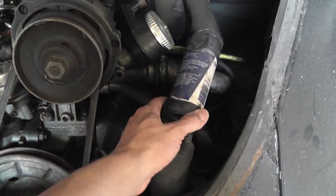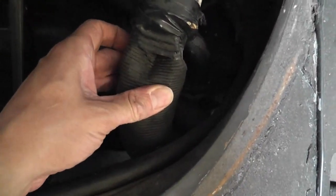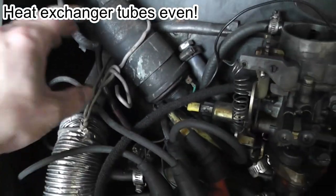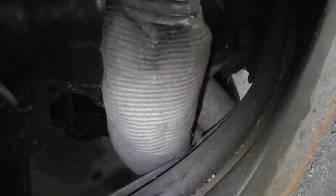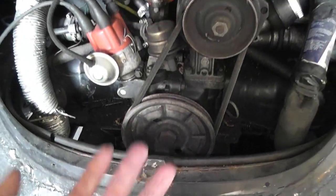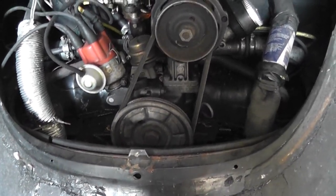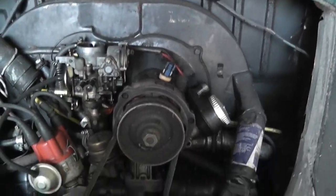This carry-on here — I don't know what in the name of God that was made of. Heat riser tubes are not exactly expensive. That one's held on with a piece of electrical wire going around the coil. The rear tin is missing completely, which if the engine is used for any great amount of time without that rear tin, it causes the engine to overheat — basically because the engine is sucking in the hot air that is discharged underneath the car instead of sucking in the nice cool air from the top of the engine bay.